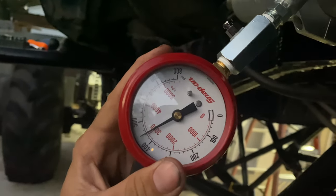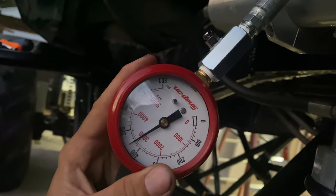That was successful - she didn't start, which is what we wanted in this instance. Let's go see what that cylinder pressure is at. 450 - I think that's good. I'm not gonna lie, I know what I'm talking about... actually I have no idea what that number means, it could be amazing or absolutely horrible. I'm going to go ahead and repeat that process, pulling out the remaining glow plugs and writing down all the compression pressures. Then the problem cylinder should present itself. Seven more cylinders to check.